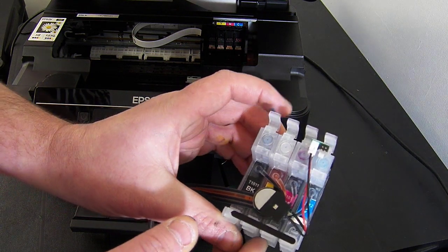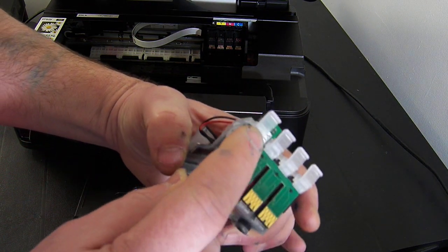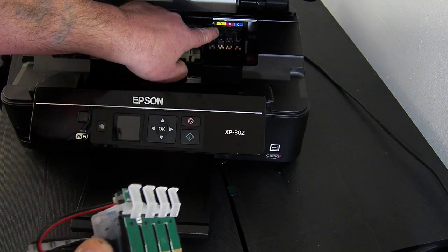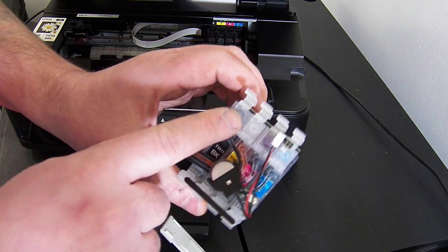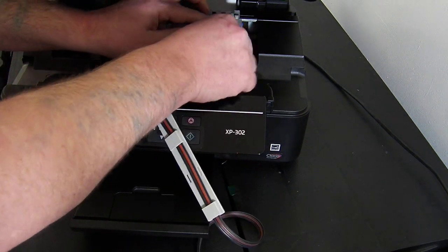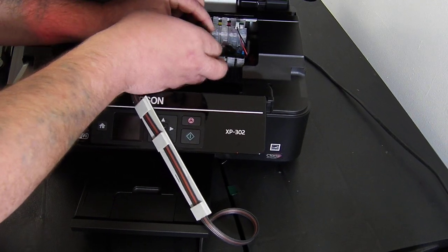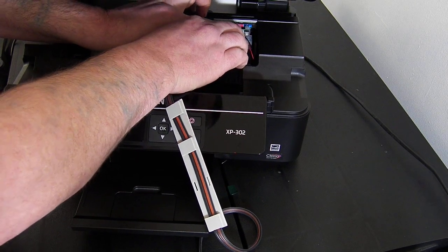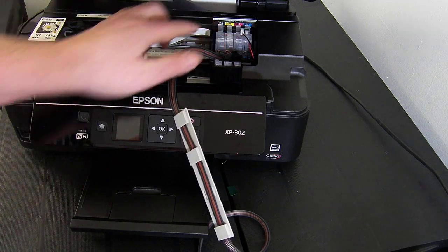So we're going to install the cartridge block. It's quite important with the cartridges — there is a tiny little lip on the edge. That lip has to be under a lip in the cartridge bay where my finger's pointing. We're going to do some secondary checks when we've put the cartridge block in. I'm going to pop the cartridge block in and then push down from above firmly at the front and at the back, just all over the cartridge.